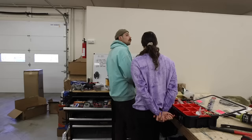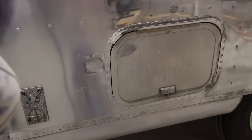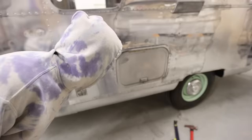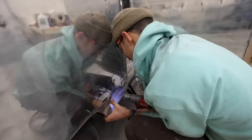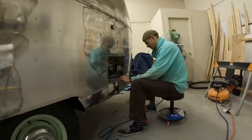When you don't know what you're doing it can become extremely paralyzing and hard to work through. But we have enough building experience to know that you just have to push through it and accept it's all part of the process. We got one little rivet in — gotta celebrate the little wins because we still have probably about a thousand left. It's time to have a riveting day. To put the shell back on we used a rivet gun and an air compressor — it's a very slow, meticulous process. With one of us on the outside and one on the inside, Jay had to pre-drill the holes because the shell didn't line up perfectly. But once we got the hang of it, it honestly wasn't that bad.